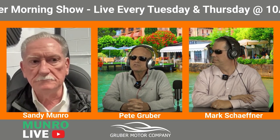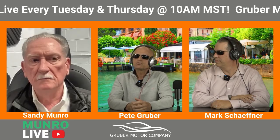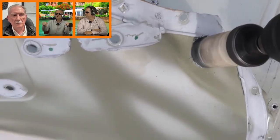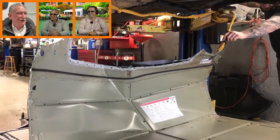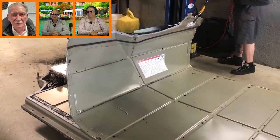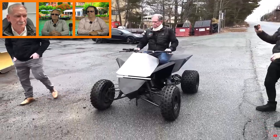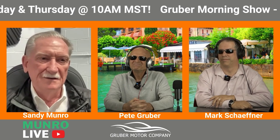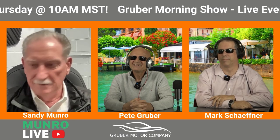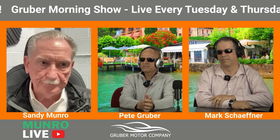That is one of the most labor-intensive parts of our process — the removal of the top lid on a Model S battery pack. If you do something like Rich Rebuilds, which is start to peel it, drill a couple of one-inch holes, put a tow rope on it and yank it off — which he's done — then he goes and makes a new top out of cardboard or something. What we have to do is body work after we take it off because we have to reuse that lid. Tesla said they will look into selling us the lids, but it hasn't happened yet.